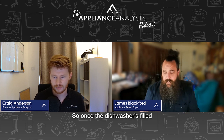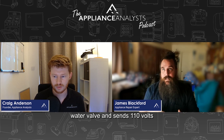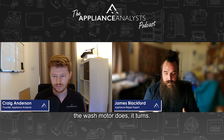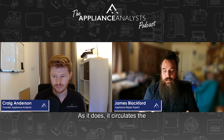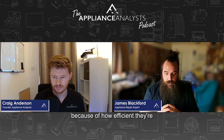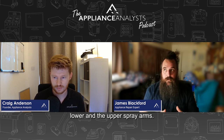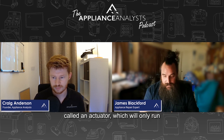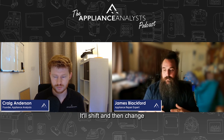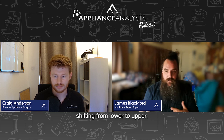So once the dishwasher is filled, it cuts off the power to the water valve and sends 110 volts of electricity to the wash motor. Pretty much the only thing the wash motor does is turn, and as it does, it circulates the water through the spray arms. The majority of dishwashers now, because of how efficient they're making them, the motor does not run the water through the lower and the upper spray arms at the same time. They have what's called an actuator, which will only run the water through the lower spray arm. It'll shift and then change it to where the water goes through the upper spray arm. So the motor's running, and the actuator's shifting from lower to upper.